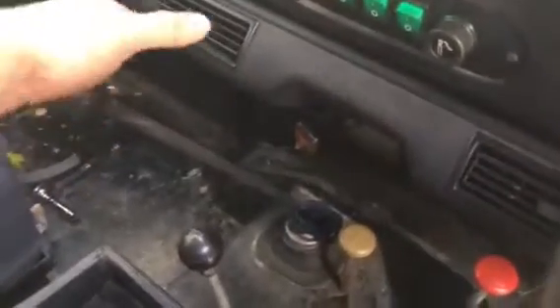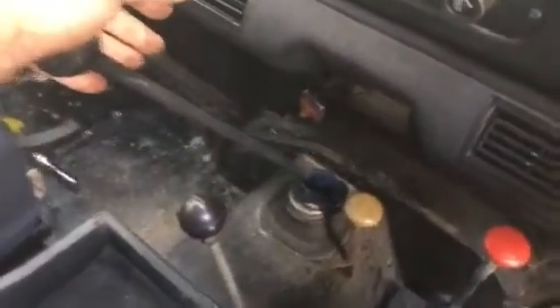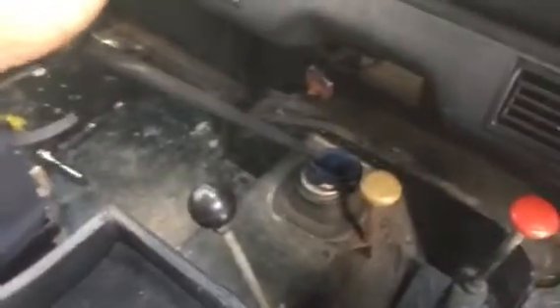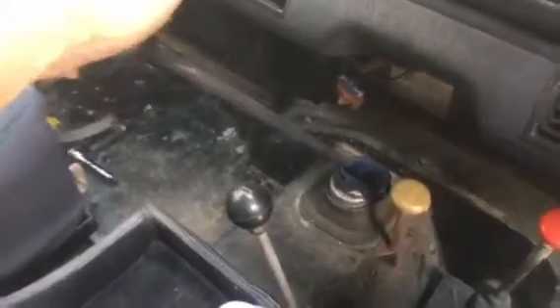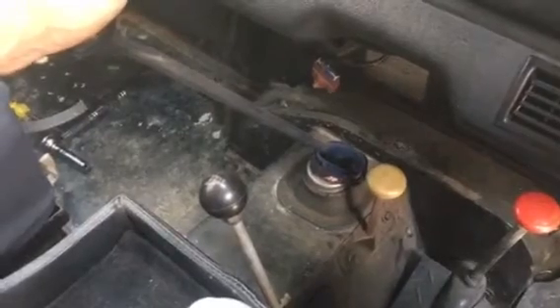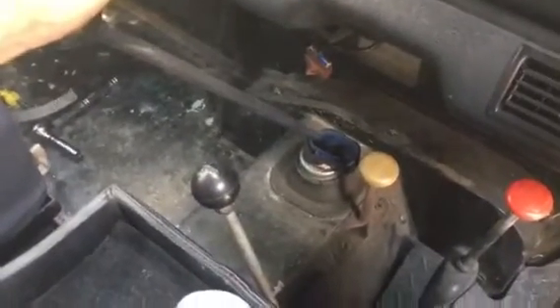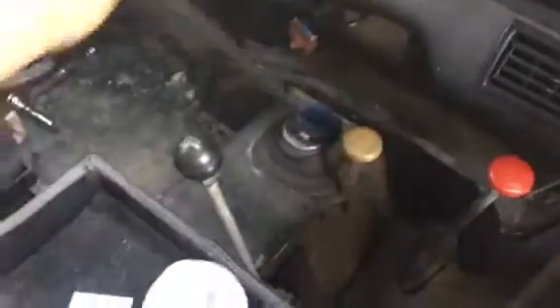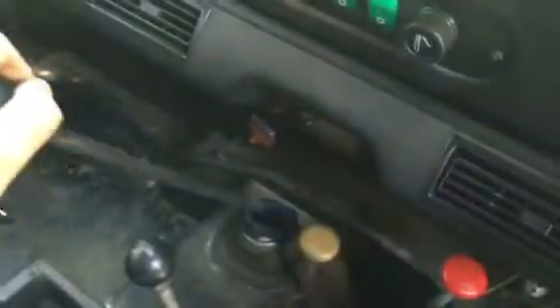What we know about this truck is that somebody drove it from South Dakota back to Colorado, and I believe they had it in four-wheel drive and didn't know it. If you love Landys, get into one and learn it - but you're driving a tractor and you can't take things for granted. The differentials on this truck happen to be different ratios for the front and rear axle, so if you drive this truck from South Dakota to Colorado in four-wheel drive, you will blow up the rear differential and snap the rear half shaft, which is what happened on this truck. The transmission actually works well - the problem is that it's in gear and I still have this much play on the shaft, so I'm going to get in there and tighten that up. But can you shift? Yeah, you can, no problem.